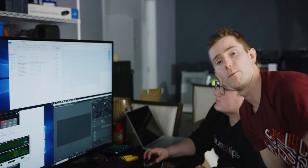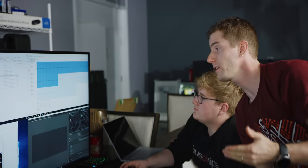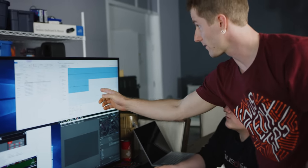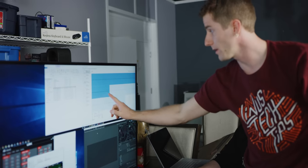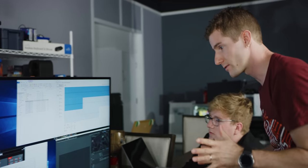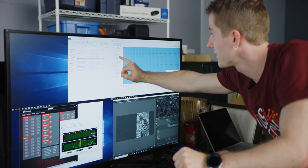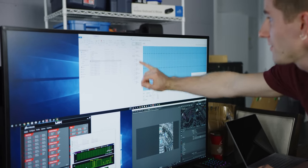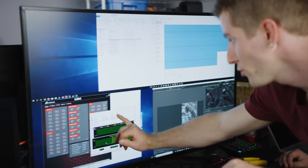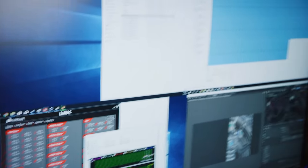Something that a lot of people don't know is that just because you have two CPU sockets doesn't mean that even a heavily multi-threaded application — like Blender, you can see it's using the entire first CPU — necessarily means it can utilize the second CPU. It just doesn't quite work that way. Alright, so here we are. Blender's running, our GPUs are all sitting at 75–80% utilization. Our CPU's at 92%, and all we can do is let it cook for a bit.